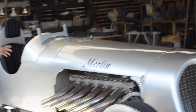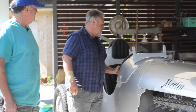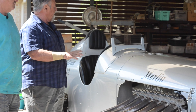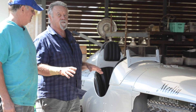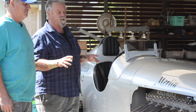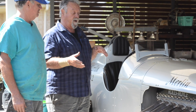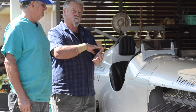The chassis I built myself, along with all the suspension — generic hot rod parts. The gearbox is a five-speed Mercedes bus gearbox. Because it's not a real high-revving motor, to get any speed out of the car I've made a step-up gearbox, built out of an NP250 four-wheel drive transfer case. I've locked it in first gear and reversed it, so instead of being a two-to-one reduction, it's a two-to-one step-up.